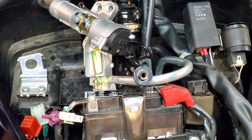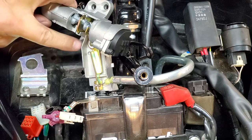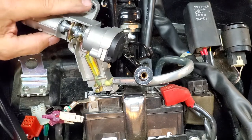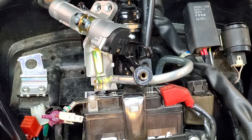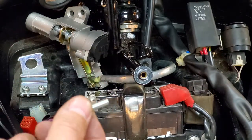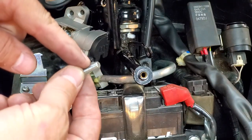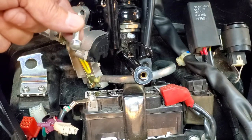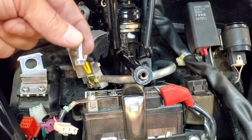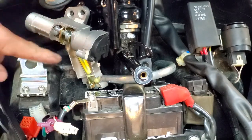The only thing you might have to think about is that the existing bolts holding all this in place are basically impossible to remove without destroying them, so you'll need to get some similar bolts. The size you're going to need is a six millimeter diameter by 1.0 thread pitch — a pretty common size especially for motorcycles. You can get it at the hardware store.